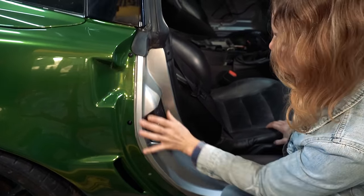Oh Lord. I'm going to work on this little switch right here because we have a problem with the high beams, which we've talked about. I don't know how to take this apart, but I'm gonna find out. I know on my old Chevy trucks, you used an Allen key to push a spring in here. So we're gonna try that. The battery is unhooked, by the way.